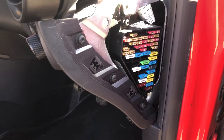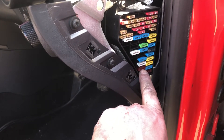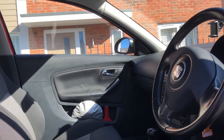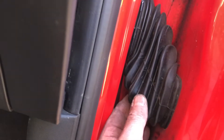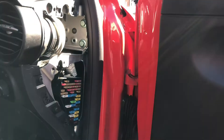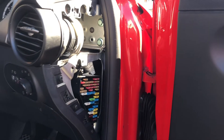Right, fuse box off. This fuse is for the electric window on the passenger side and also the electric mirror - it had popped. It now works, as does the mirror. So there is definitely a short somewhere. You can see the wires chafing on this side - it's a common fault on these Volkswagen-type cars. I'm not in the mood to pull that out and have a look today, but at least I know the motor's okay.